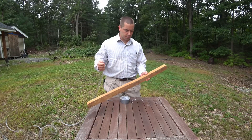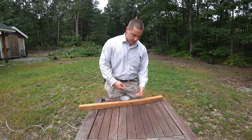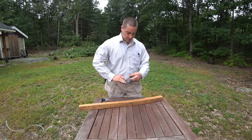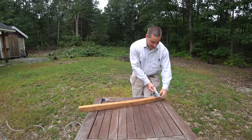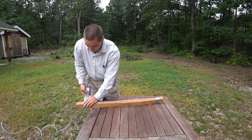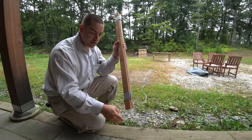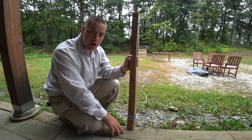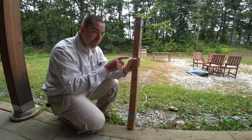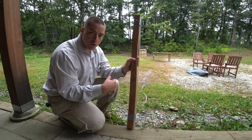For this other end of the vinyl tube I'm going to tape it to a stick — it doesn't really matter what kind of stick you use. The bottom of the stick is right here on this timber, so that's what I want to reference off of so I can mark where that grade is all the way around the yard.